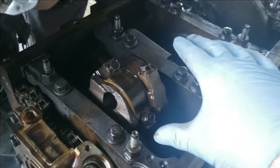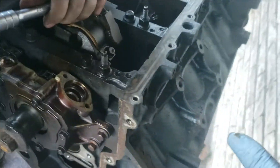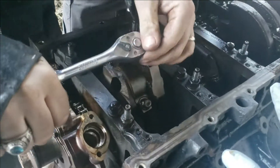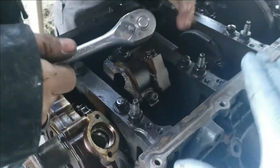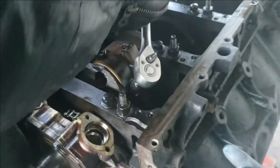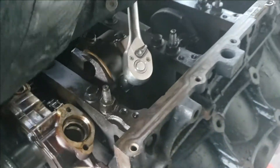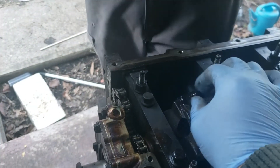You don't want to pull all your rods at one time — do one each time, that way you don't mess anything up. And another thing to know: each LS piston does have a dot underneath it and they always point to the front of the motor. These bolts are torqued to yield, but you can reuse them up to three times.